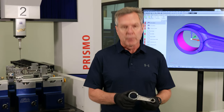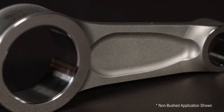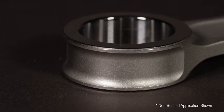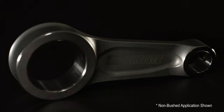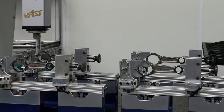This Racer Elite Connecting Rod uses proprietary steel and different heat treating methods to control hardness in the beam versus on the thrust faces. We've done some really proprietary things such as removing weight out of the big end but retaining a wider thrust face for better heat transfer.